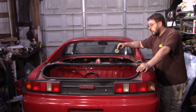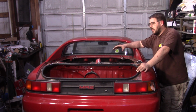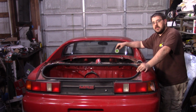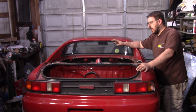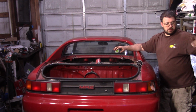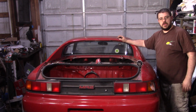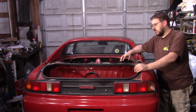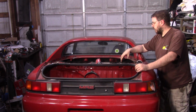And yeah, so some of those other camshafts are much, much, much bigger. I'm hoping that one of those camshafts ends up being the camshaft that goes in the final engine for Evey that is going to get us all the way to 350 wheel horsepower, but it's a little early to tell that. The 250 wheel horsepower number I feel pretty confident about because I've got an engine in Tanya right now that makes 231 to the ground, and I've got an engine sitting over there that made 241. So I've got a pretty good idea what it takes to make that kind of power in these engines. So 250, not a huge leap. I feel pretty confident that we're going to make that number.